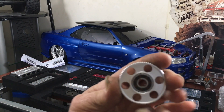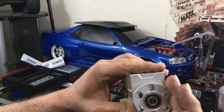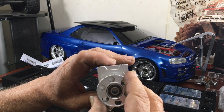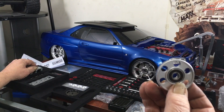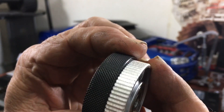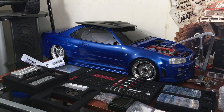Follow the directions — I think they say the brown side of the starter one-way bearing goes out. When the engine runs, these turn counterclockwise, so the starter motor turns counterclockwise to start it. If you put it in backwards it'll just spin freely and won't do anything. Also, there are a couple of little washers you have to add so that the starter spins freely without rubbing against the back of the flywheel — make sure you follow the directions on that.